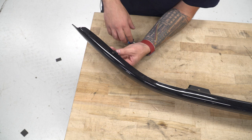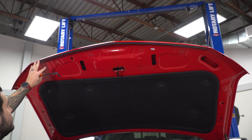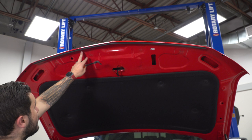Grab the Phillips head screw and tighten it down on top of that bracket. Repeat that on the other side. Under the hood, there's a weatherstrip sealant, and inside of that there are little plastic black pushpin clips all along it. On each side, we have to remove the second and the fourth one in from both sides.